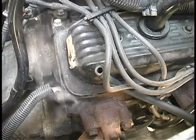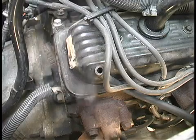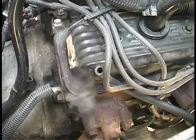It's not uncommon to find oil leaks above fluid level while looking for vacuum leaks, but think about it, these oil leaks are vacuum leaks.